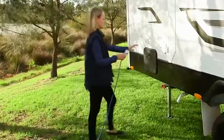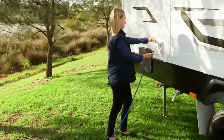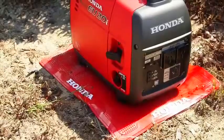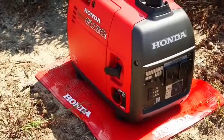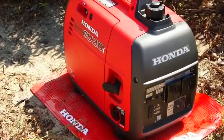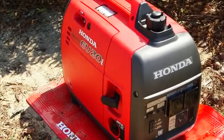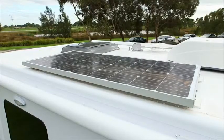It is imperative that your leads are 15 amps. This will allow you to plug into a 15 amp site — plug the mains power into the van's power inlet. If you are in a remote area or plan on travelling into such areas, we suggest that you talk to your dealer about a generator applicable to your van, or a suitable solar system, if applicable.